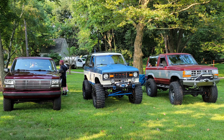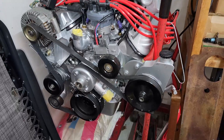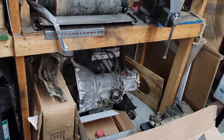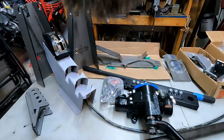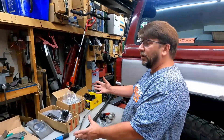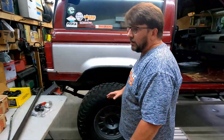Shortly after that, we decided it was time to start tearing apart for our next big upgrade, which is going to be a complete powertrain change. We had a 347 back in the corner, and behind the bench hidden is a C4 with a reverse manual valve body. There's the shifter that goes with it. And just imagine there's an Atlas transfer case here too that hasn't shown up yet — I ordered that back in April, and hopefully sometime this month I'm going to get it. So, 347, C4, 4.3 Atlas is what's going in.